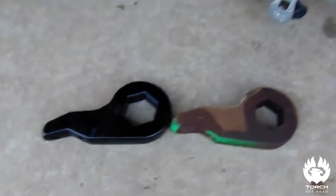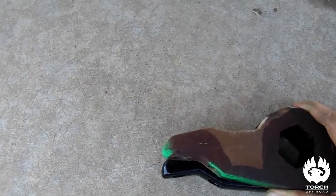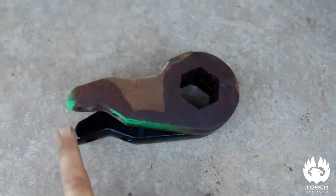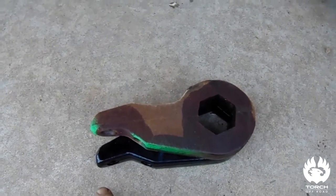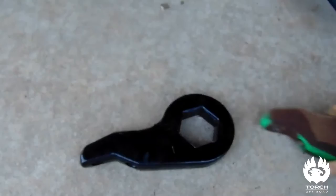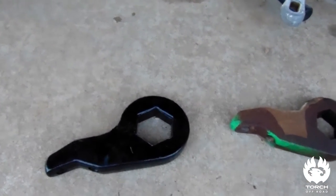Check them out — not much of a difference, right? But if you line these keyways up, there's that much of a difference right here. That's where your lift comes from. With it being torsion, you can adjust it however you want, but just be careful — if you turn those torsion bars up too high, it rides horribly rough and you can break them. Anyway, we're gonna get this new one in and button it up, put the wheels back on and see how it looks.